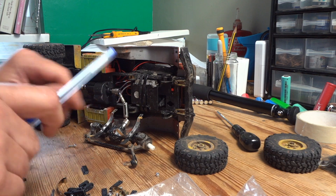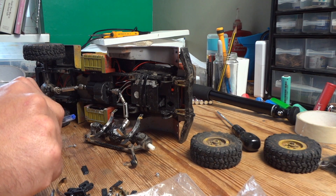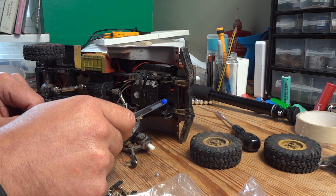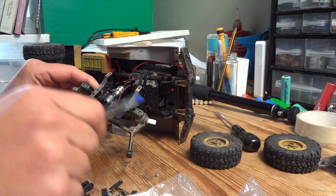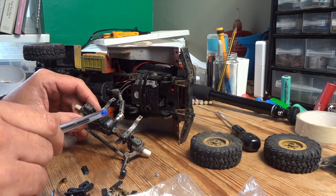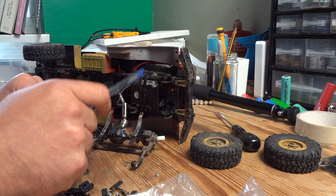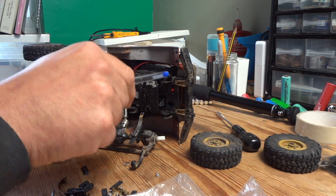The first thing I've done is remove the tires, unbolt the springs and the axle from the body of the truck, and unscrew the steering servo horn from the arm, so this assembly is completely off the truck. I'm going to try and sneak the upgrade kit on without disconnecting the drive shafts. Next step is to remove these hangers — the kit comes with hangers which replace these.